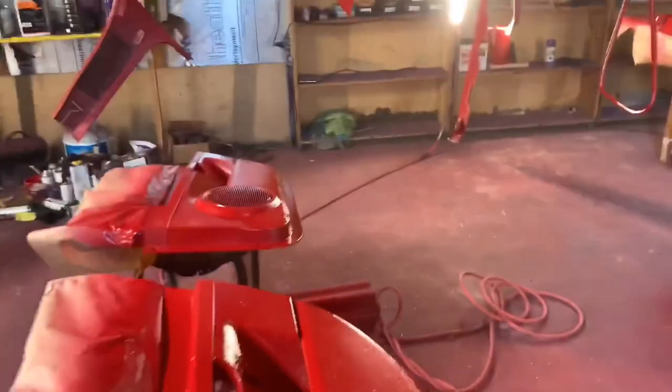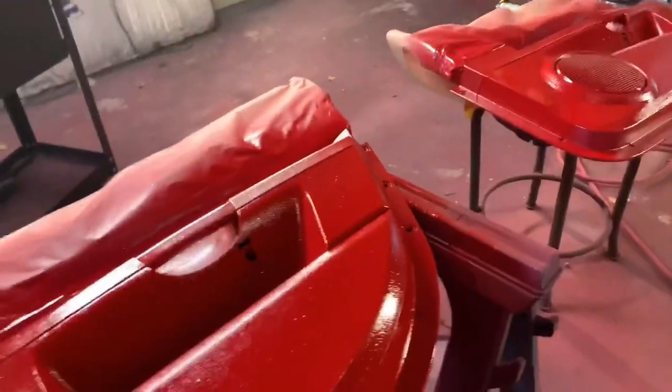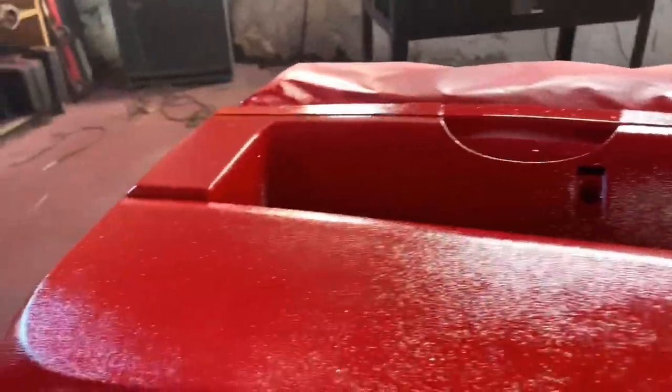If you ask me to get rid of that grittiness, you would, like I said, throw a sheet of glaze over the whole thing. It's going to be some work. Throw a sheet of fiberglass or glaze the whole thing, Bondo, some thin glaze or whatever. Smooth it, sand it out to fill in those crevices. That's just me. I don't know, you probably have to ask a professional. I honestly think if you put enough primer on there, it should fill it in really smooth, the grittiness and the texture.